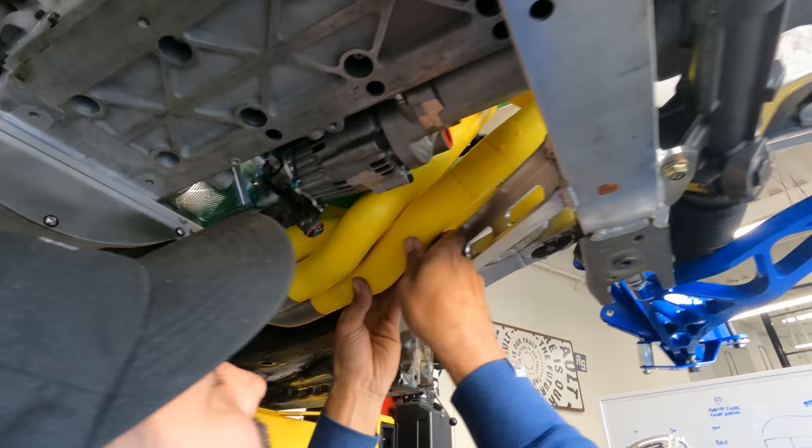So we're actually getting a new arm. This is for the OEM Supra style, which has a divorced spring. We're gonna be getting one that bolts more like our 8.6, where it's just an arm that contours straight over and it just has the pickup point for our BC Racing suspension to bolt to. So it's not a divorced spring, it's a regular coilover.